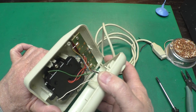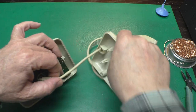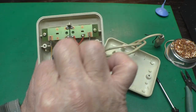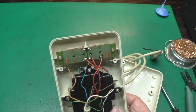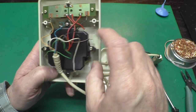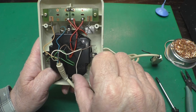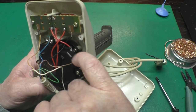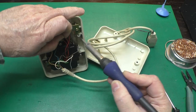Now we can separate this, but there are wires holding things together. If you rotate this part like that, you can slide it down there, and you're left with this mess. Only these two wires — the black and orangey brown — unplug from the switchboard. Everything else you have to desolder. So I made a little map here that tells me where everything goes. I originally marked which side was up on this switch block, but once I got it apart I realized it's rather symmetric.